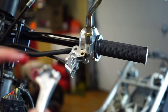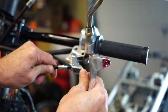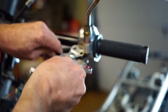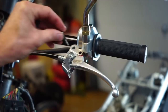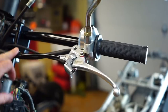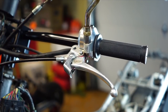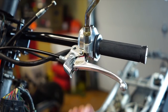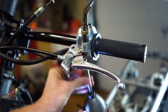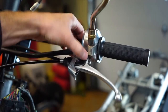Remember our dry levers — I'm just going to grease those up on the pivot points, same with the pivot point of the cable. Slide it through our little area here and get it in its groove. Notice the little seal is still there. Now get it in this groove and I can flip it around. Now since I lubed that pivot point up, it'll be way better. Make sure that it's lined up. As far as the cable, here's our old cable — I'm just going to copy where this went so it's basically where it was factory. I need to put the 10 millimeter nut up under here before that. There it is, and the little rubber cover here — that just kind of pops and holds onto the Phillips head.